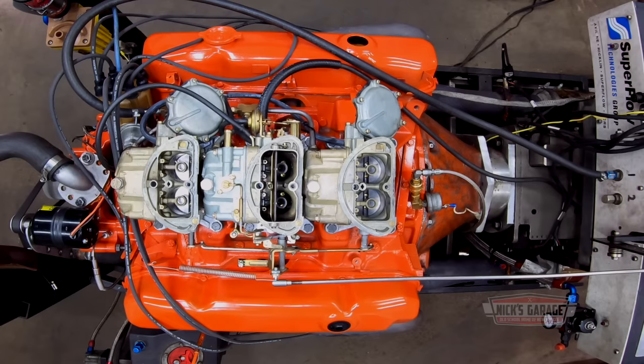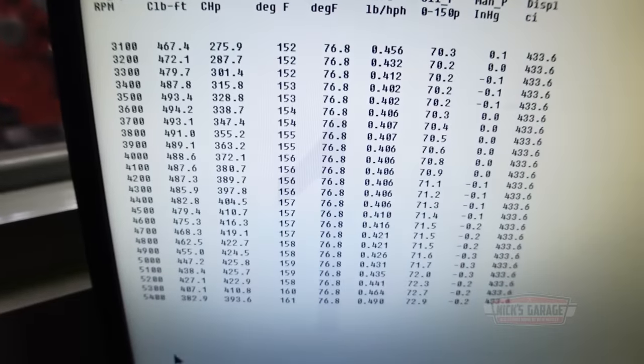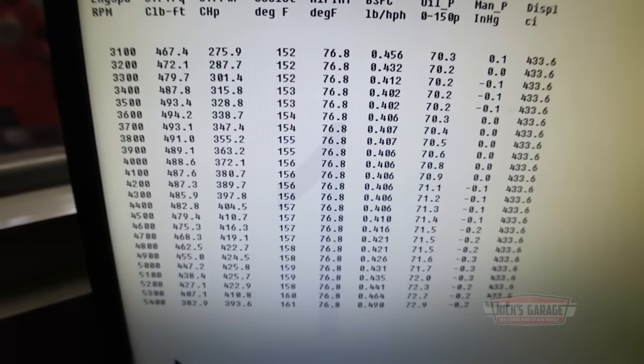Okay. But we lost the run through the torque, 30 RPM back at 1,000, eh? See, instead of leaning, did you notice that the stumble is less right now? Yeah. Okay, that's good. Now the torque numbers. You know that if we lean it out, we're gonna get more torque, you know that, eh? Yeah. I want to see a 500 on the torque numbers.